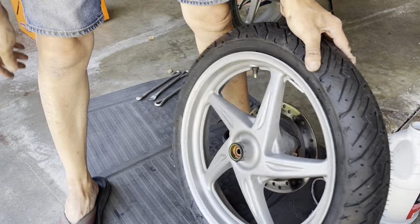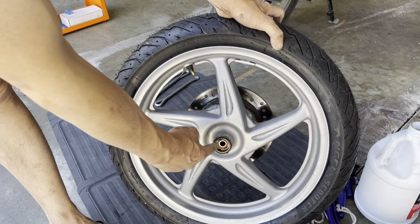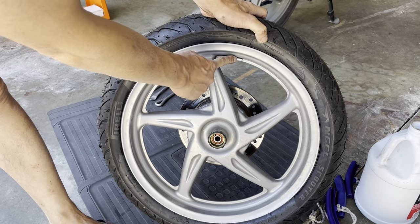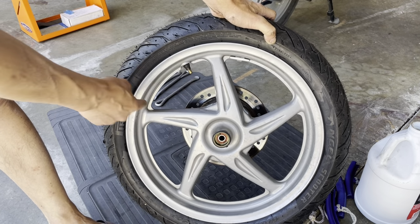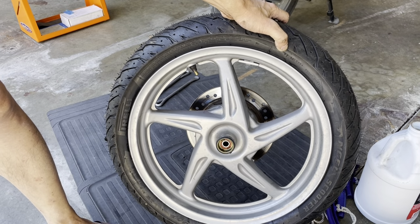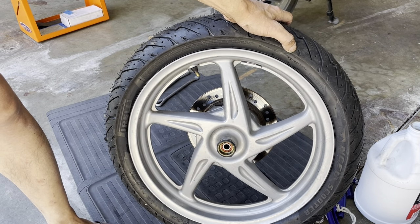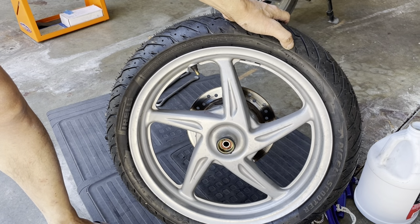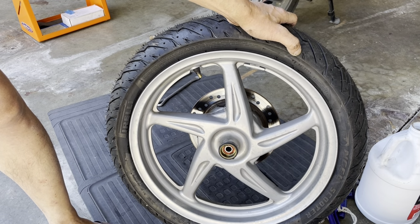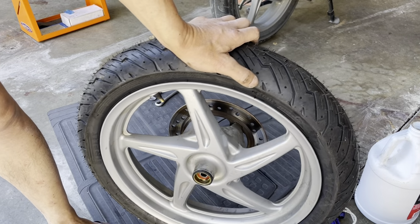So that's it. That's front tire mounting. Again, I can't balance it because my axle size here is too small to fit on my balancer. So here's the stock OE factory wheel balance. I just left it on there. It's usually the wheel that's off balance, not the tire itself, especially with modern tires. So I'm just gonna leave it there and see how it goes. If I get shaking or whatever in the front, then that means the balance is really off. I could take it off and take it to the shop and have them balance it for me. That's it. Thanks for watching.